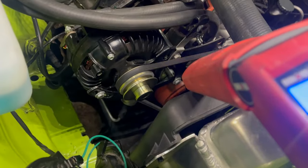It hates 12 degrees base, but with the vacuum in play it's very happy. The question is how much of that vacuum goes away when you hit the throttle and how hard, and at what RPM does the mechanical advance come in — it's a bit of a balance. I don't know if we can run 50 degrees of advance at idle or how bad it's going to ping. Next I need to put it on the ground and find out. But before I actually drive it, I'll swap the dial-a-phasing cap back to the nice one. And how does it start? Good — that's how nicely it starts with the vacuum advance.